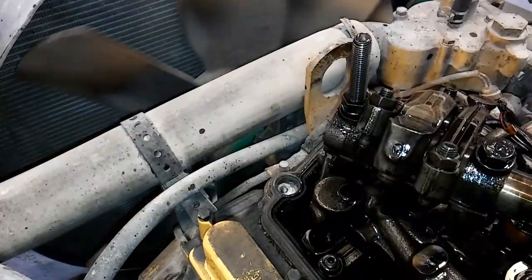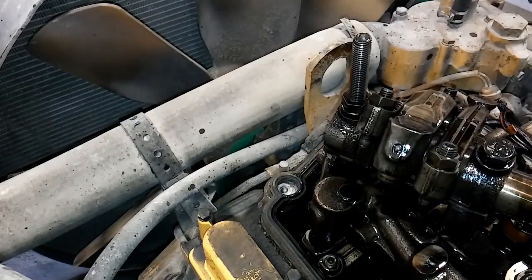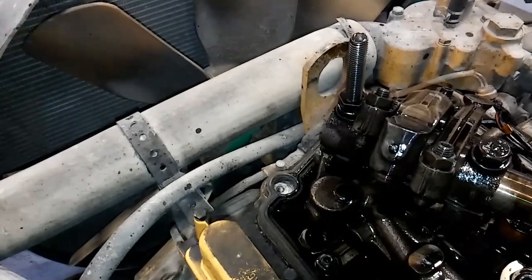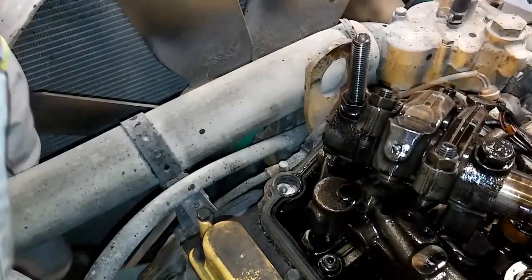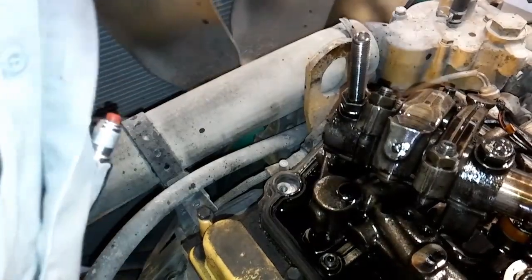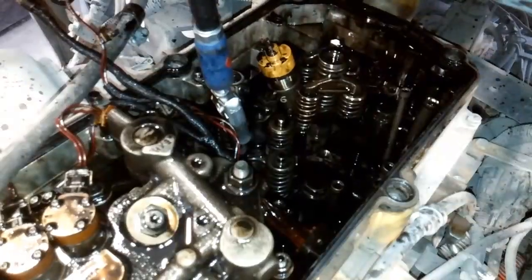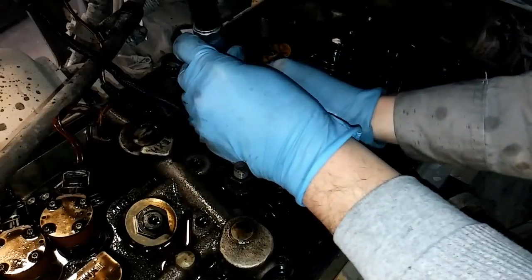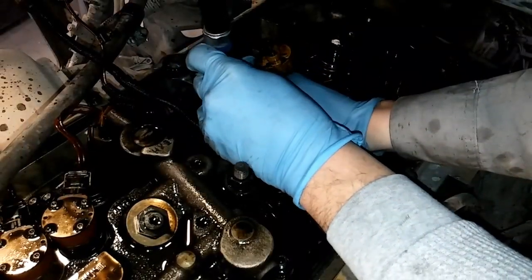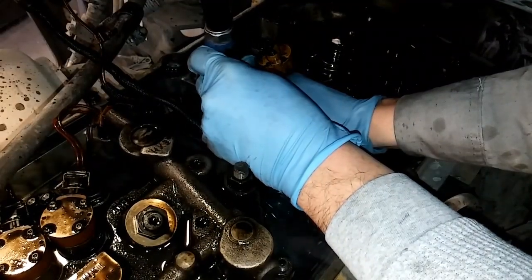Now once you start filling the cylinder with air, you should notice the crankshaft rotating — unless the piston is already on bottom dead center. If it doesn't rotate, it might be at bottom dead center, or you might have a bad cylinder. So if it doesn't rotate, you might want to rotate the engine around to a point where it's above bottom dead center and then see if it rotates. Now I suspected we had valve damage here, and we do because the valve height is different. It seems the valve is still intact — it's most likely that the seat of the valve has failed, and that's why it's raised up in the cylinder.